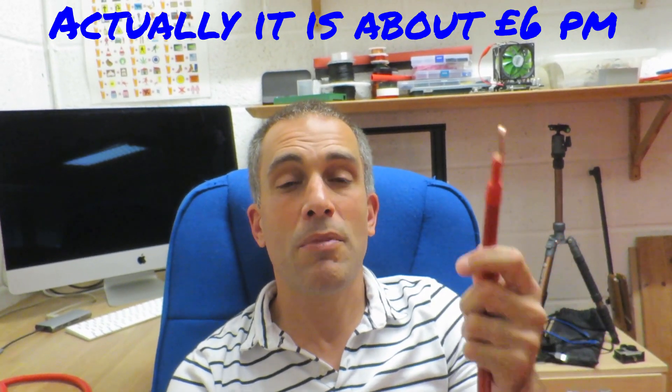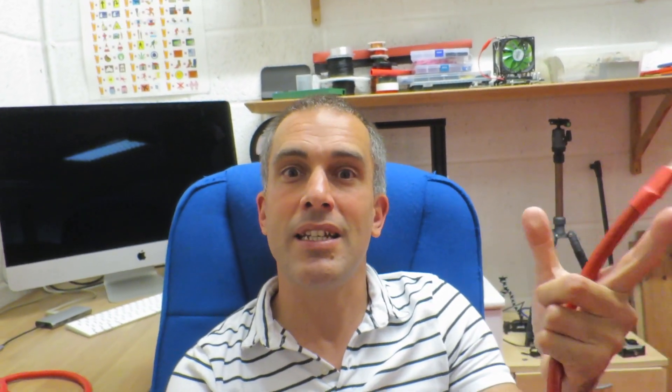I make my own cables — I buy the cable in, cut it, and make them. A really important point is that you use pure copper cable. You can buy copper-coated aluminium, known as CCA — it's not pure copper, and you're going to suffer from a lot of losses and temperature issues. It may even melt. It's not going to be good for the high amperage you pull in an EV car, so make sure whatever you buy is pure copper.